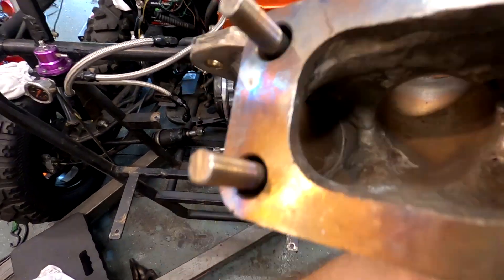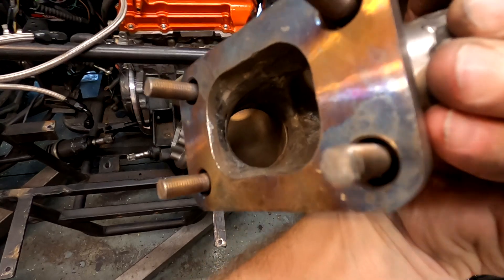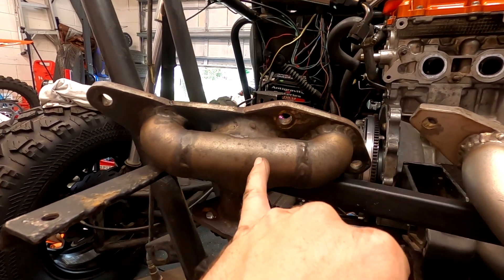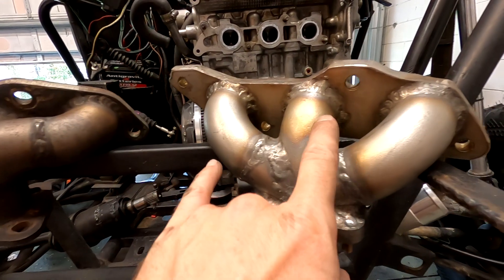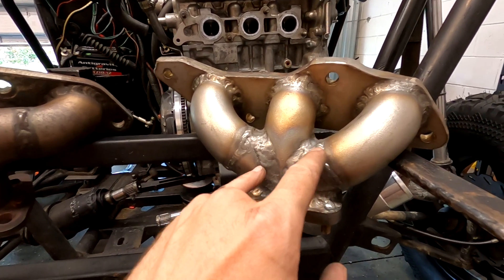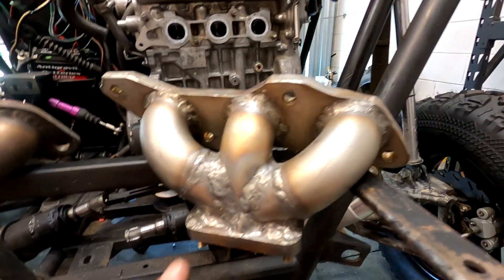I came in here and just like I do with all my other stuff, I hogged out nice smooth openings. I even hit a little bit of a taper on this corner and on that corner, and you can see that airflow has a nice direct shot. On this design, the exhaust gases are coming out - that gas is going to continue on straight until this one fires and then it comes back this way, and then this one fires and pushes it all down. If I put this design on the previous setup with the other turbo, I could possibly see a 20 or 30 horsepower gain. That's going to make all the difference with this big turbo. We've got to get the gases out of this engine as quickly as possible.